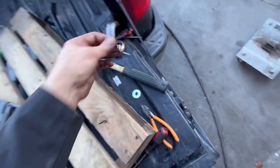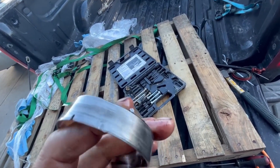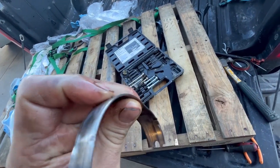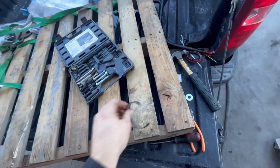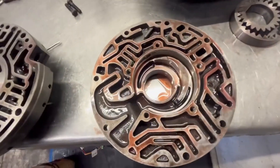That's really the only flaw in the pump - we lost this bushing bore. I'm wondering if the bushing wasn't staked. Let's look at that real quick. You've got to do everything you can to keep these in. That from my screwdriver is not a stake mark. I don't think this guy was staked in, but even when it spun that's possible - maybe those are staking marks and when it spun it knocked them out. Anyway, that pump doesn't look like it's going to hold another pump bushing securely like we want, so we'll have to address that.